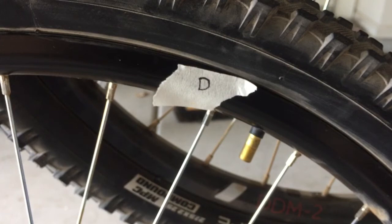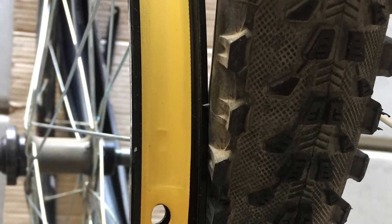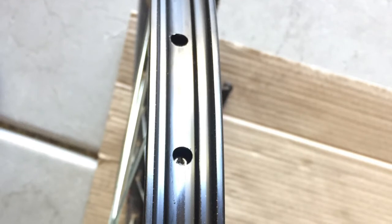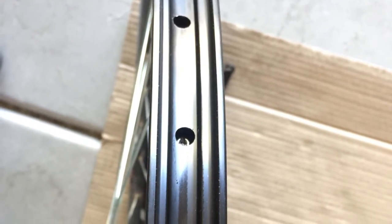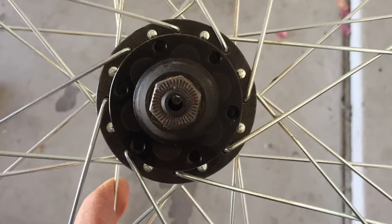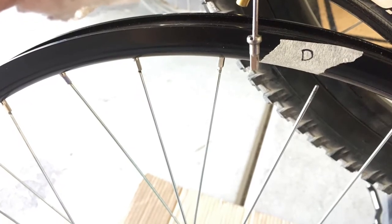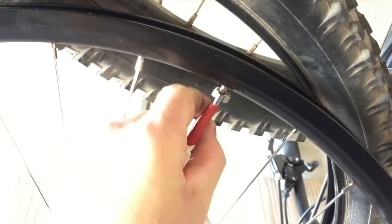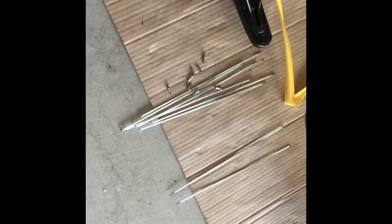I marked the drive side of the rim with some masking tape and removed the tire and tube. Next you have to remove the rim tape to access the spoke nipples. Note how the spoke holes are offset to the left and to the right — be sure the hole offset to the left has its spoke going to the left flange and the one on the right goes to the right flange. I removed the spokes and kept track of their orientation as they came off the rim, putting them in separate piles for drive side versus brake side and inner flange versus outer flange spokes. My spokes were actually two different dimensions — I have a slightly shorter spoke on the drive side versus the brake side.